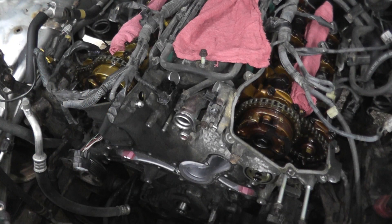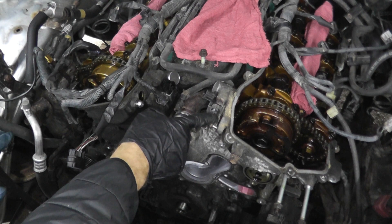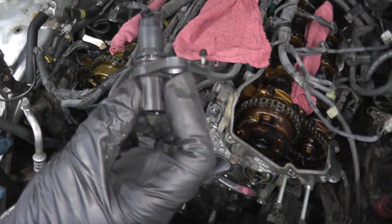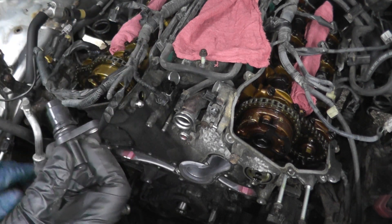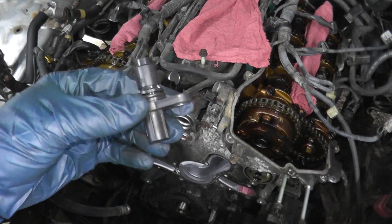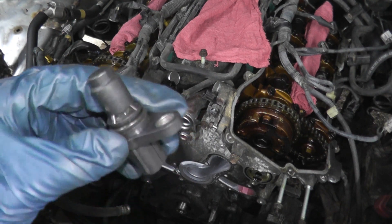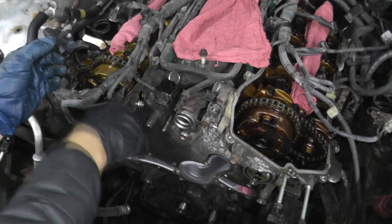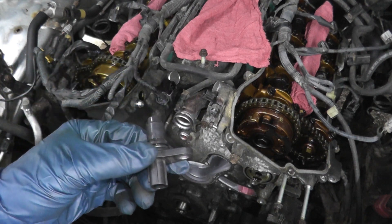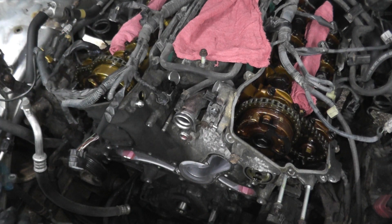I just realized I removed both camshaft position sensors. Bank one is the passenger side, bank two is the driver side — this is bank one, and trouble code P0016 is what we're tackling. It tells us there's an issue with the timing chain. I've read on many forums it may just be a cam sensor, and the dealer from whom I purchased the vehicle tried this route — a brand new Denso camshaft position sensor. You can even see they replaced the fastener with a brand new one, but this did not do the trick. If you have this trouble code, it's a mechanical issue unfortunately — you just have an issue with the timing chain.